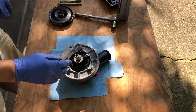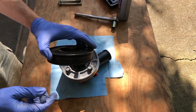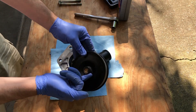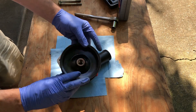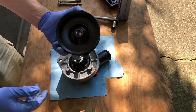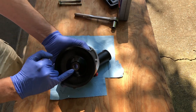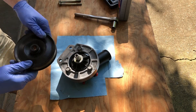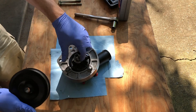You want to put some grease on the pump shaft. I've already put grease inside the pulley here, so that's good to go. Make sure you've got the lip here facing out — don't accidentally flip that because you'll never get the pulley back off. We're just going to use our pulley tool and tighten it all the way down until the surface meets right here. There's no specific torque amount — you just push it all the way down until it meets the surface.